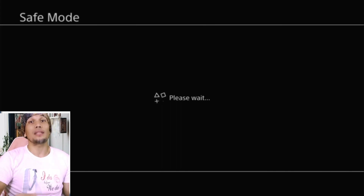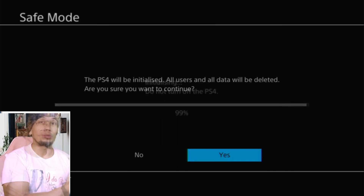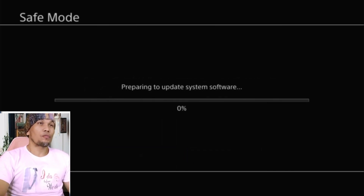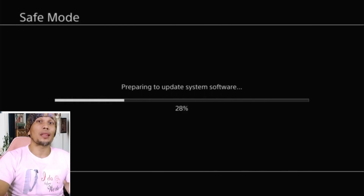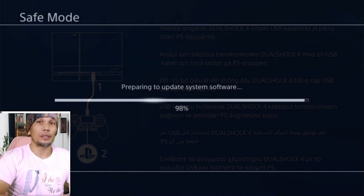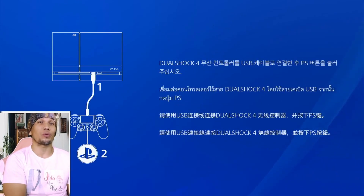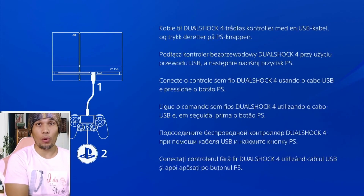For the reinstallation process or when changing the hard drive, you need the reinstallation file. Once you are on this screen, select Yes. One more reminder: before you get to this part, make sure you have carefully chosen the exact reinstallation file your PS4 needs. If you are on 9.0, you don't want to install any firmware higher than 9.0 — unless you use your PS4 online, in which case you'll need the latest update. Once you complete this step, you have successfully changed the hard drive and reinstalled the firmware, and you'll just need to run the initial setup.